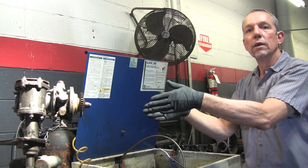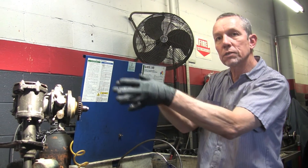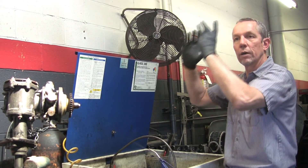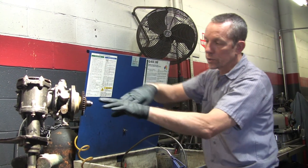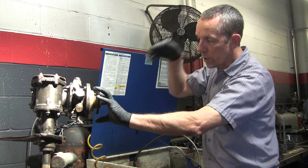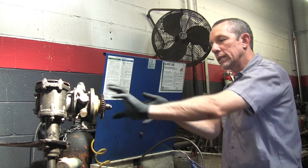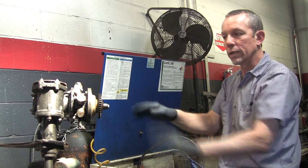There's no steering wheel connected here. On the Silver Cloud II and III, this is offset a little bit from the steering shaft coming down out of the car. So there's another gear right here — there's a transfer box, they call it. The steering wheel comes down this way and it turns this gear, so when you turn this right, this one goes the other direction.